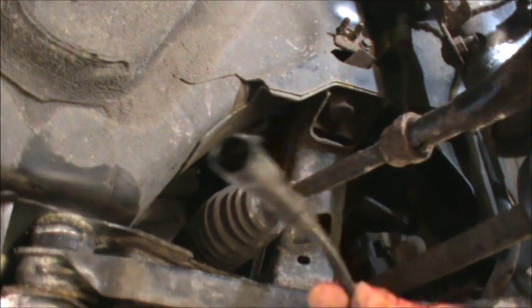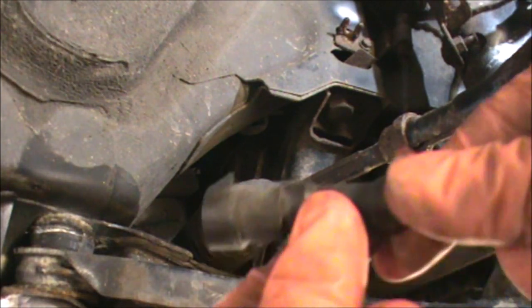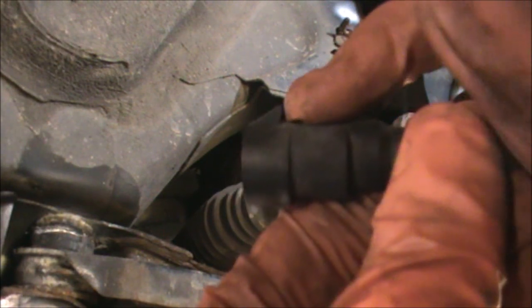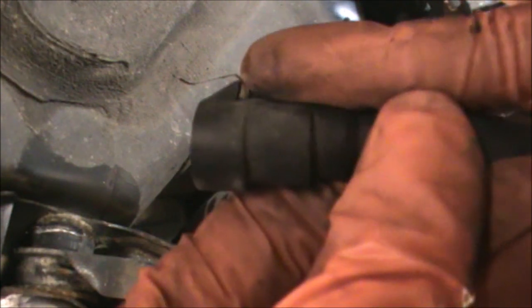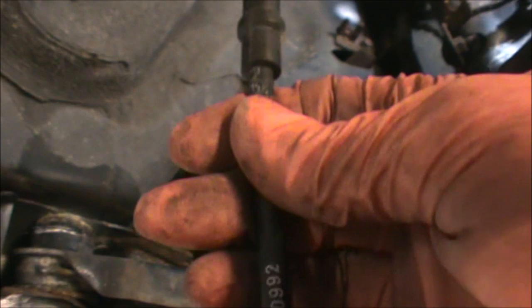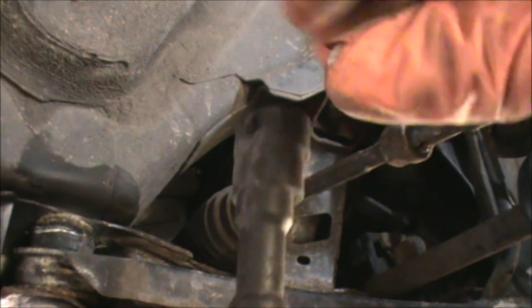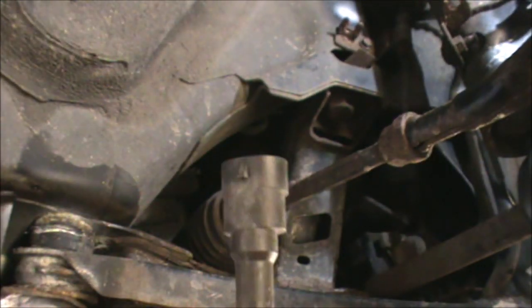Okay, that's the head of the sensor. So it's plugged in. It's holding on by this bit here. So you need to get the little red tag up, and then you're able to release the little flap that is on top of this. And then this comes out. It's in between one of the brake pipes. So you just have to pull the brake pipe out very slightly, because you don't want to damage it, and then this will come out through there.